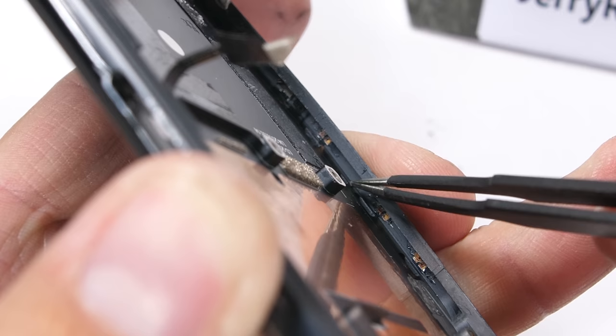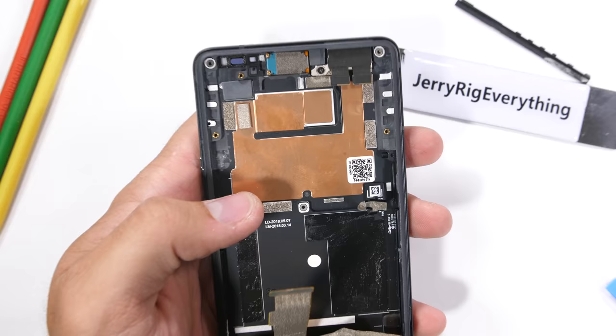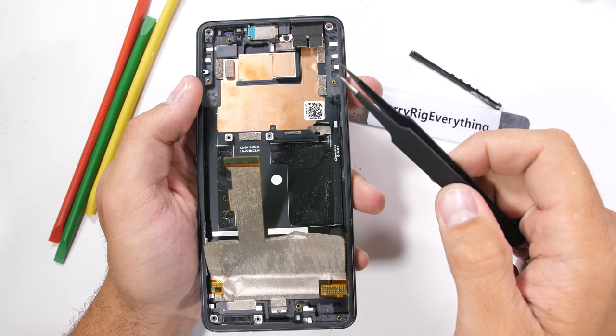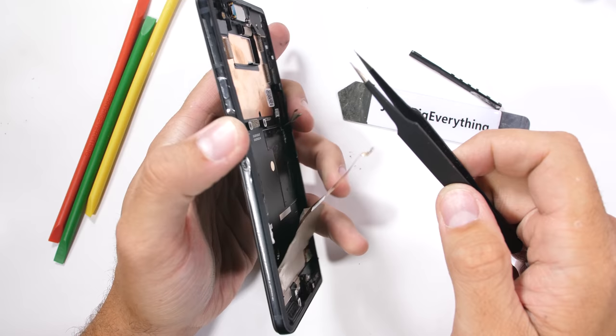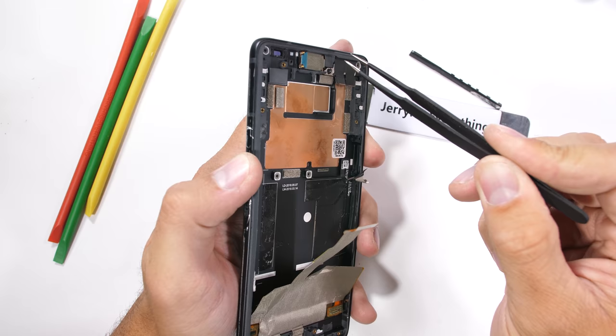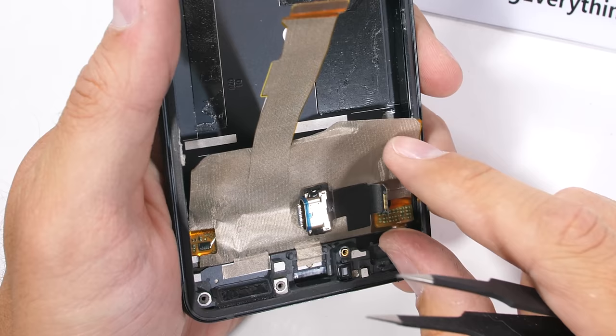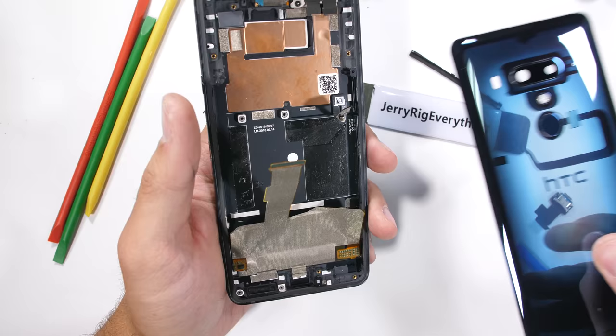You never realize how often you use a power button until it's gone. Here's a close-up look at the contact points remaining on the inner side of that metal frame. Normally in a teardown video I would reassemble the phone so it's working after I'm done. It's pretty annoying that something so inexpensive and common as a button is rendering my $800 phone useless. To make matters worse, the screen of the HTC U12 is permanently glued to the frame and would be very difficult to harvest for parts, so reclaiming any value is going to be difficult. The HTC U12 Plus is currently in the lead for the least repairable phone of 2018.